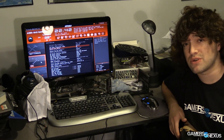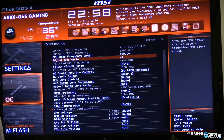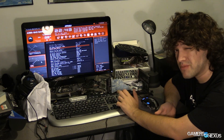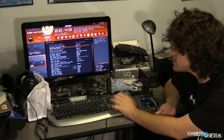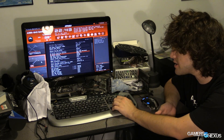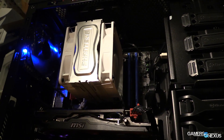We can increment the multiplier slowly to higher values and hope the CPU remains stable at the higher clock rate. I normally suggest jumping straight to 40 or 41 — that's not too huge an overclock, so it should remain stable. We're going to jump to 41 because I've already tested and confirmed it's stable at 4.1 GHz. If you want to try stepping higher — into the 4.2 to 4.5 GHz range — you might want to start running liquid cooling, because the CPU does run a little hot and accurate measurement software is unfortunately hard to find.